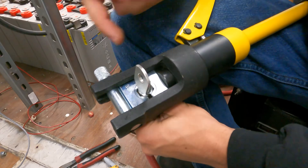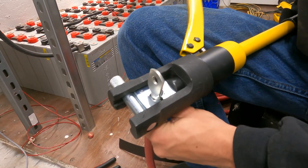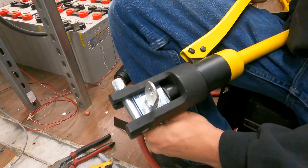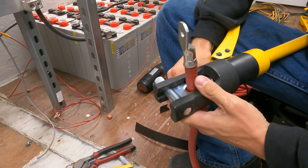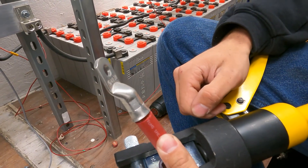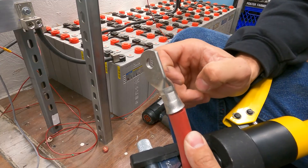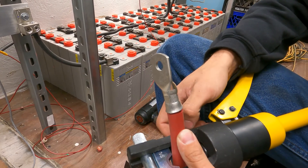On my crimps, I like the top and bottom to be flat. So this is the first crimp I will do. Once it's lined up exactly where I want it, I can go ahead and crimp this — I'm going to go until these dies touch. Essentially, that gap in there will be gone, and once that's gone I can release the tool. There I have my first crimp. On these lugs, I like to go a little bit more, so I'm going to scoot down a little bit and give it one more crimp. Some cheaper tools can't do this — you typically need to do one crimp and then turn it a sixth of a turn because you'll get little parts on the side that squish out. But with this tool it does it pretty well.